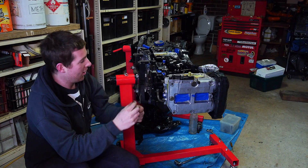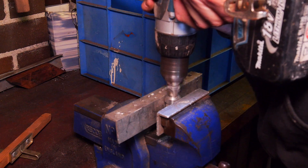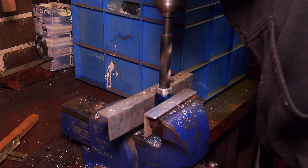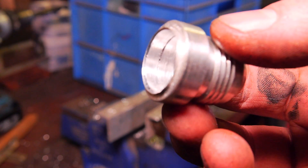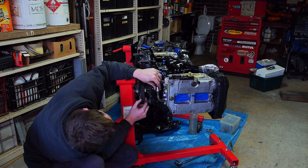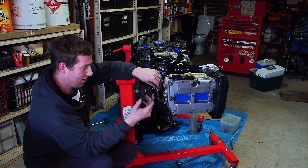So what I've done — this measures at the widest point roughly 18mm. I've gone through with a step drill and reamed that out to 18mm, then used an 18mm drill bit to counterbore it a bit deeper so we've got a shoulder for this to sit on. It sits in by probably a good 8mm or so and actually forms a pretty good seal in there just as it is, though obviously it's not tight yet.